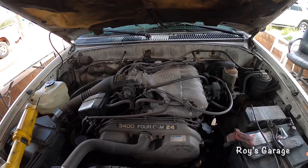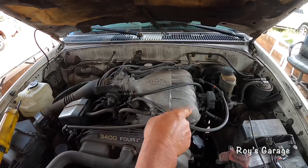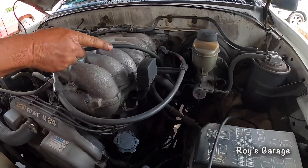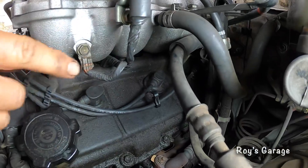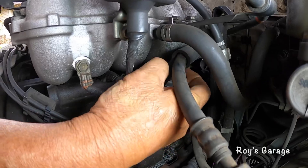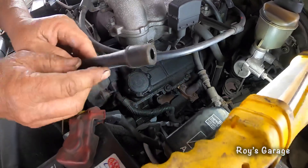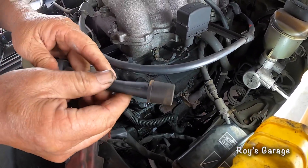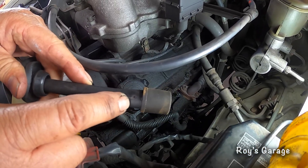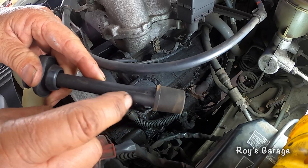This vehicle has a V6 engine. The cylinder order is 1-3-5-2-4-6. So we're going to be pulling the number four spark plug wire and removing it. We'll be checking the wire to make sure there's no burn marks or holes. Right here there's a hole — the spark is shooting out and grounding into the cylinder. That's an indication the wire has got to be replaced.